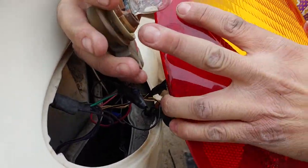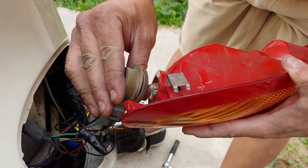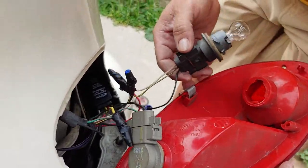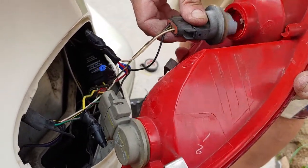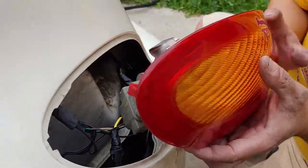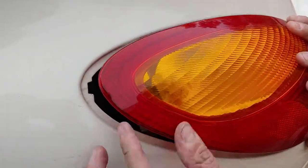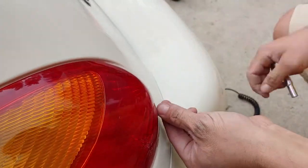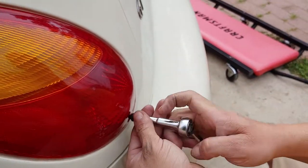So now I'm going to go ahead and put the lights back on. This one is short and little, this one is wider — the light also has a small section and a wide section, so you're going to be looking for the small and the wide. This one goes like this, and then it turns as it snaps in. This one also has three sections — two small little tabs and then a big tab. Look for the big tab to the bottom, then line up the two small tabs and turn it. There it is, it clicked. That's all it takes to get this thing done. And that's also how you replace your light bulbs too, or if this would crack and you needed a new tail light.